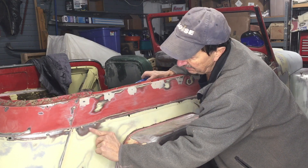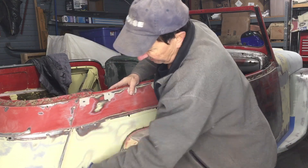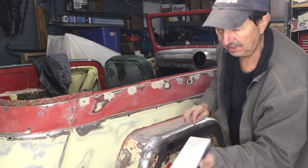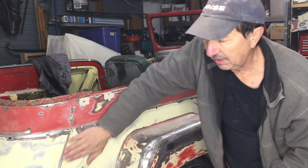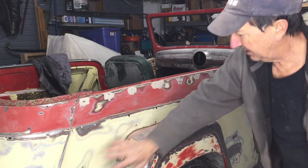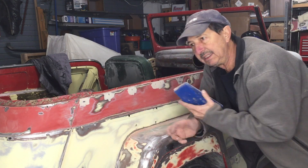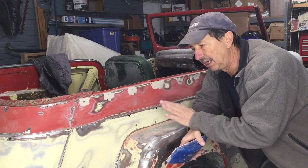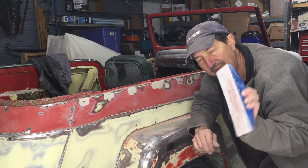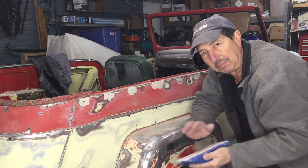These fenders I had to strip to bare metal because the paint was failing and there were little pinholes of rust — absolutely had to take it completely off. But here I just don't see any reason to remove it. Same with this yellow — it's been painted once since the factory, been in a really good environment in Oregon where the paint just lasted. It's still very solid with good bond and no rust behind it. This is 40 grit sandpaper so I'm leaving a pretty heavy scratch, and that's going to be my adhesion surface for the coat of filler over the whole body.